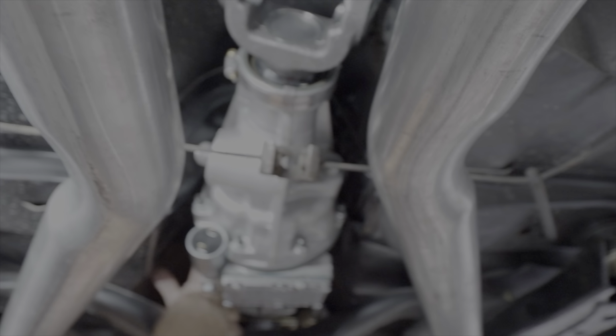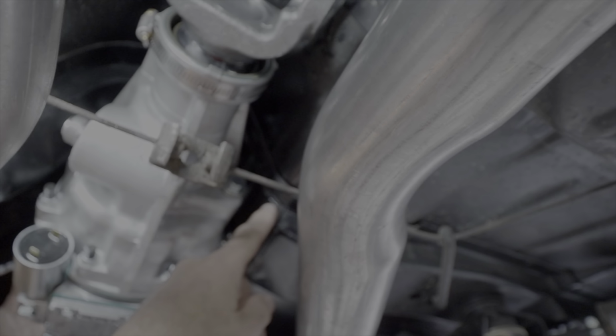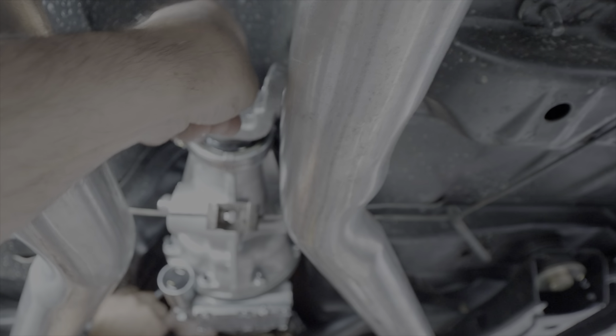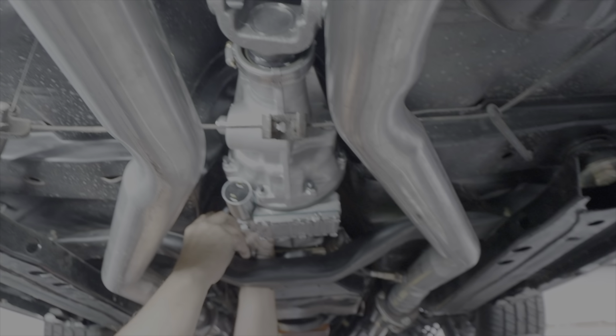Very, very tight. So anybody with a second gen Camaro, you're going to have to cut this bracket out here in the floor, because you can barely get your finger in here, and you got to cut it like I showed before. You're going to have to cut it all the way around the top there to get that in, and that's one thing they don't really show you.